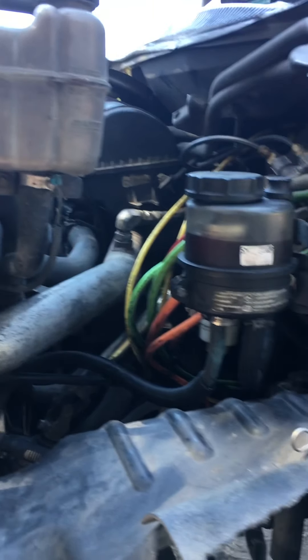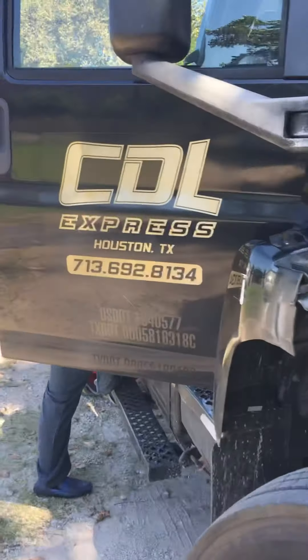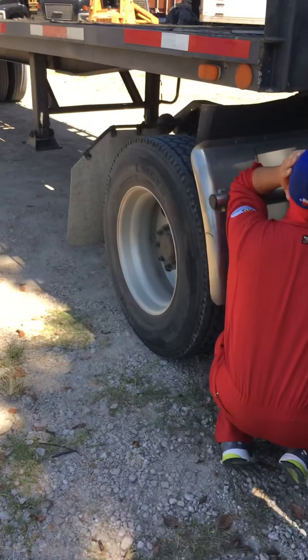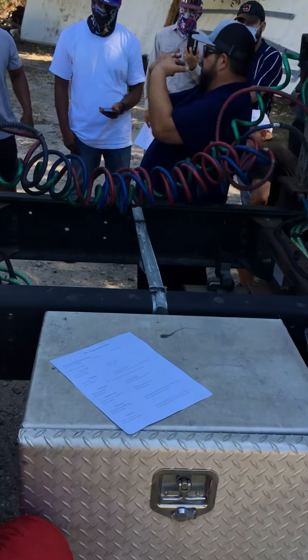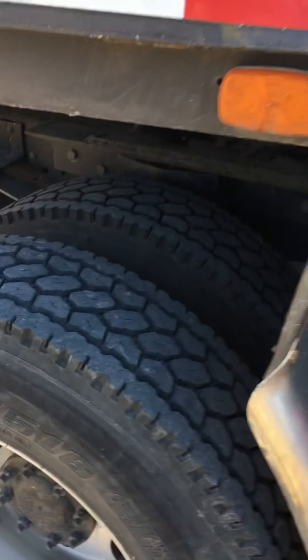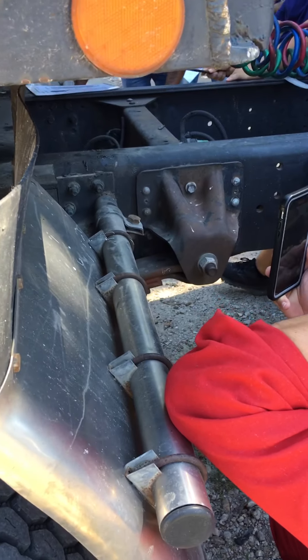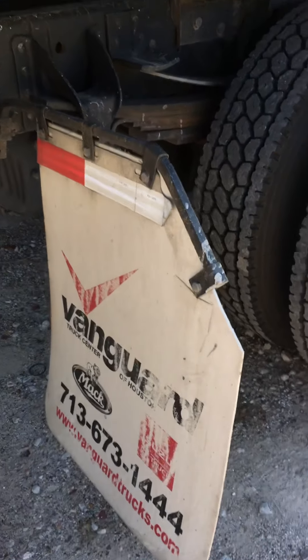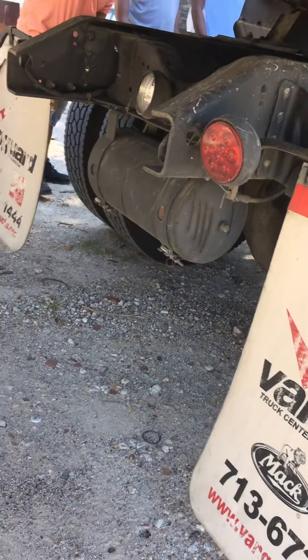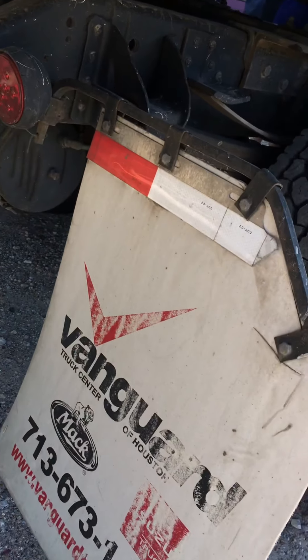So this is the apron — it is welded to the bottom of the trailer. There are no nuts and bolts, only welds. I have to make sure that it's nice and flat because I want it to be able to slide on and off of the truck easily, and also make sure that it can turn easily. You can also see that it's full of grease — I will make sure that it's full of grease.